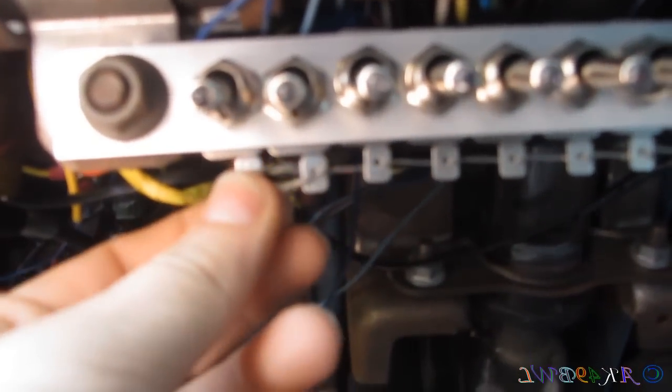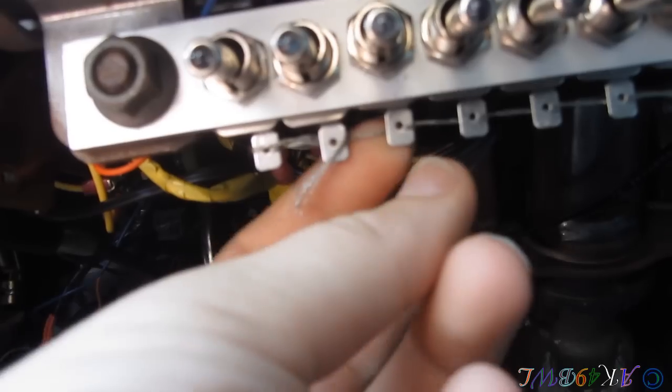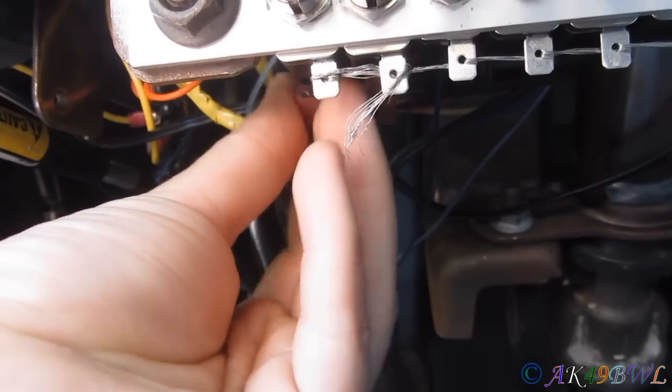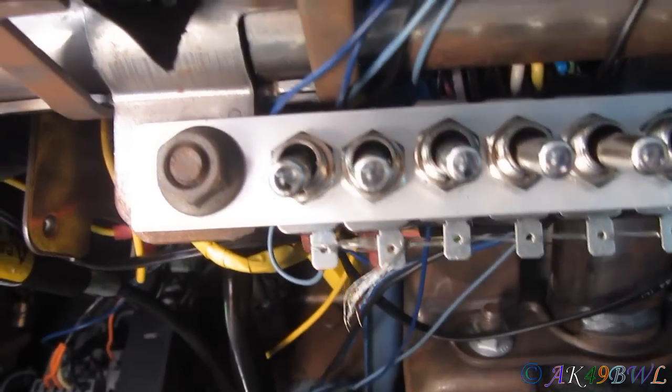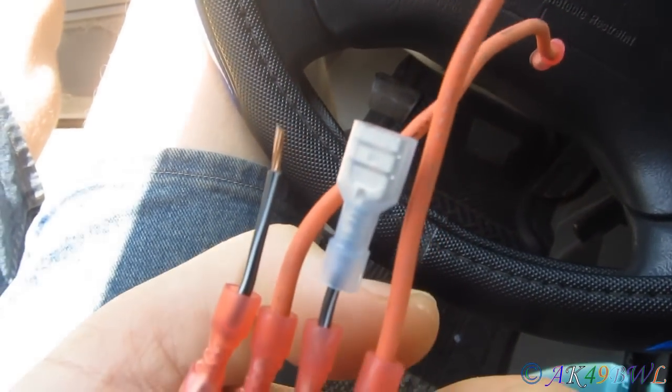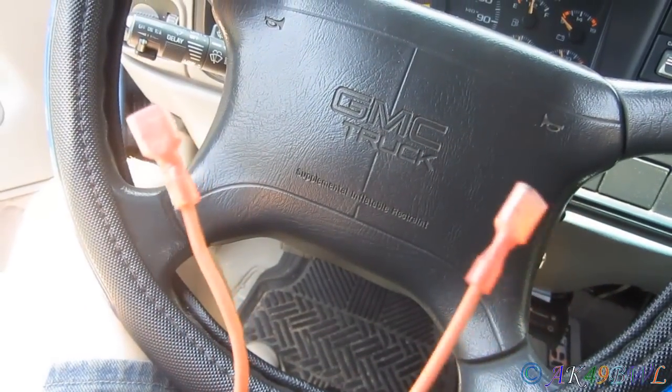I've got a couple other things planned — not only for this wire here but for these two switches for the e-fans. I'm going to pull this wire off these two contacts and leave it at the third one, and these two switches are going to be controlling relays to power the fans because these are ground-activated wires. I built a little relay pack — it's kind of a mess but it'll get the job done. These two wires here go to the ground side on the LED, and these two go to the switch side, with constant power to the center terminal.